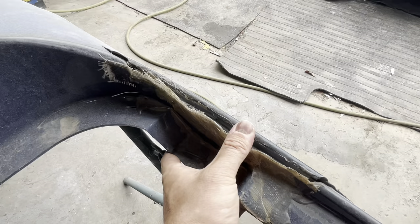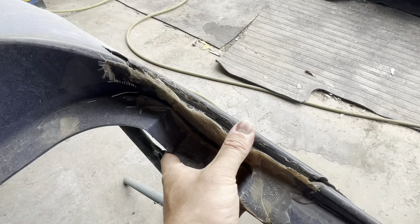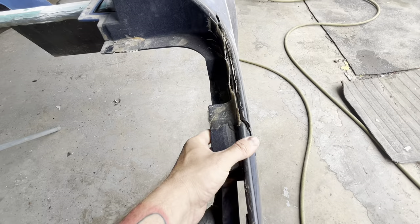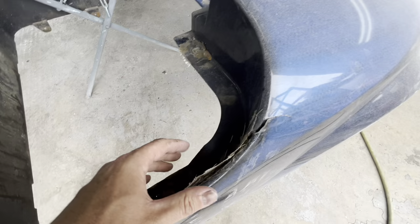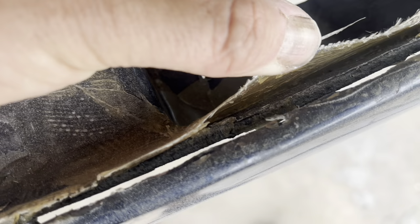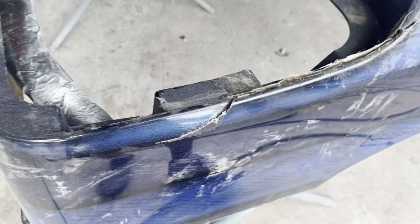We are going to go through here, undo everything that somebody has done, and show you how to fix it. This golf cart body is completely split right here on the edge all the way down it, and this is not the easiest repair. We're going to remove this failed fiberglass — it's not even sticking, not even adhered to it. That's the issue. When people try to do this fiberglass stuff, they just do it wrong. You really shouldn't be fiberglassing plastic parts like this at all.